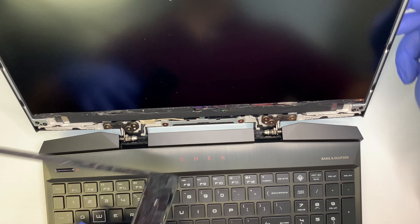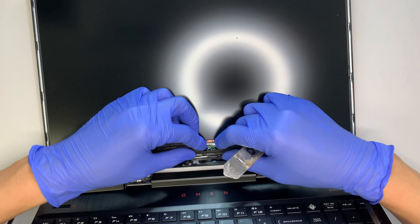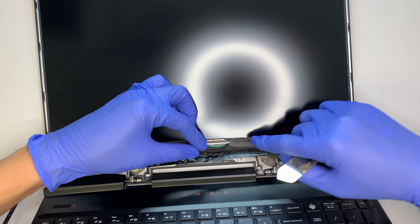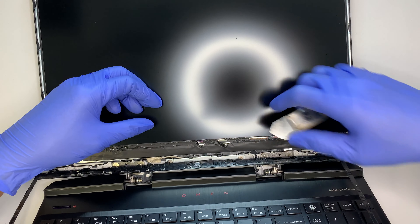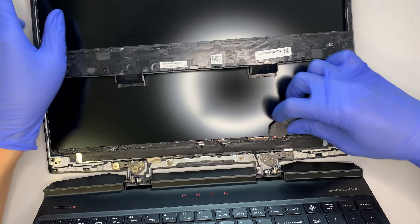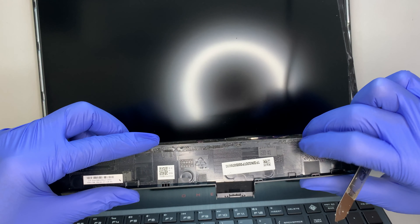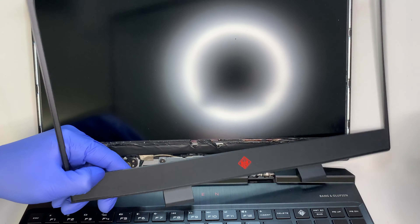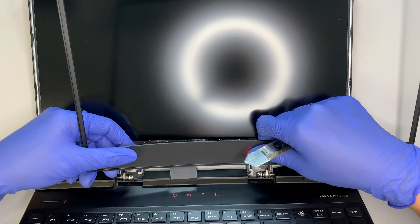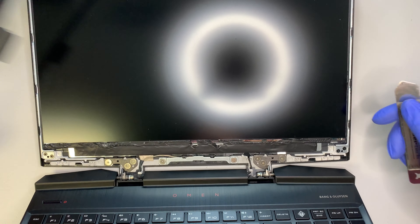I'll explain again what I was saying about the black tape right here. This is the black tape — it's a black plastic that is part of the LCD altogether. So when you try to cut in between, you're not cutting anything internally to the LCD. You're just cutting the adhesive tape on this part right here, which is the part that is taping onto this plastic. I'm just cutting the double-sided tape on the top right here.